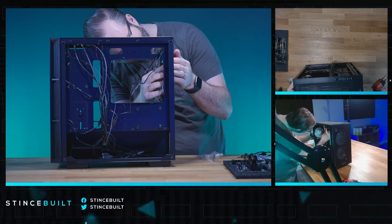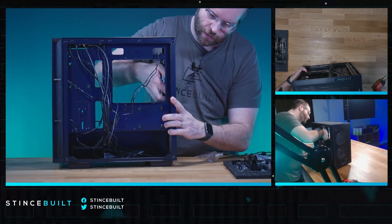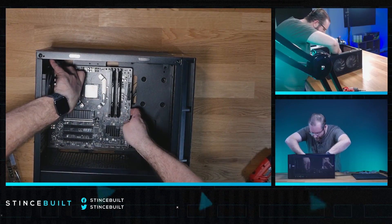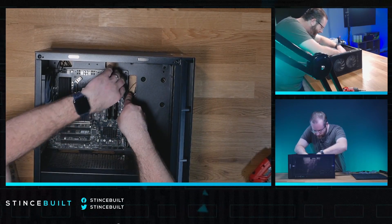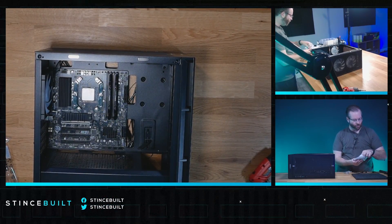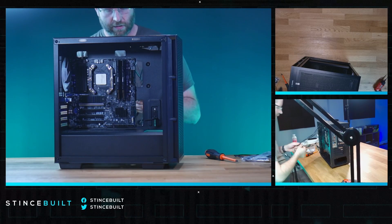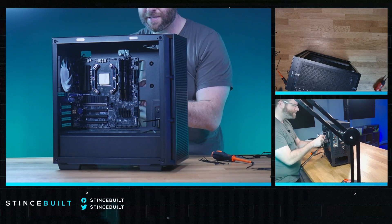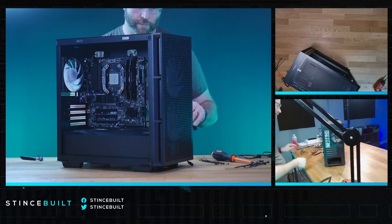Let's go top-down and put this motherboard in place. All of our standoffs are in place, which is a win. A couple weeks ago we had a case that did not have the motherboard standoffs pre-installed — that's cheap to me. There's no reason why you shouldn't have your motherboard standoffs installed from the factory, unless you're really marketing to Mini-ITX first over MATX. So shout out to Deepcool for having those already installed. Motherboard all inside the case. These fans are a little bit of a mess — we're going to work on that. The case offers Type-C, and this board actually does have Type-C as well. That's a huge W for a $100 motherboard to have a USB-C header.